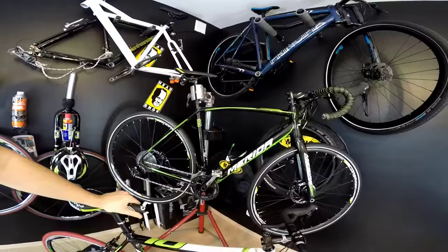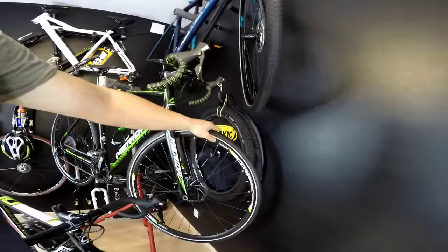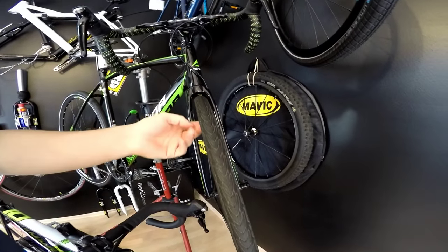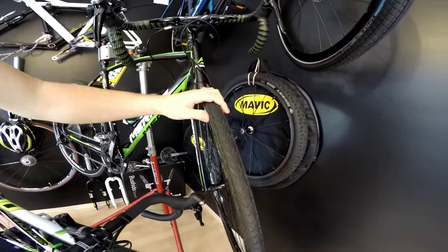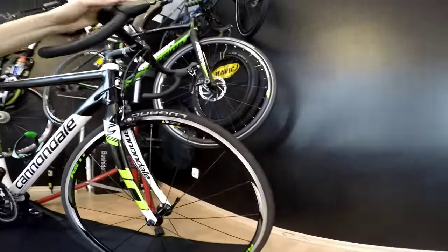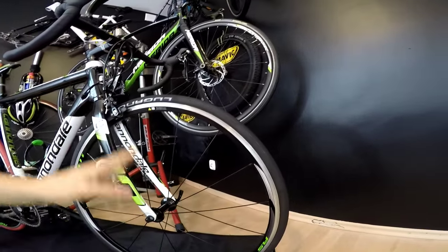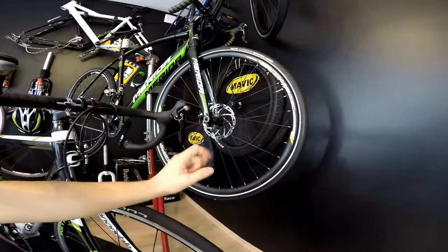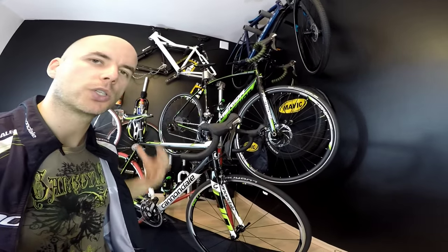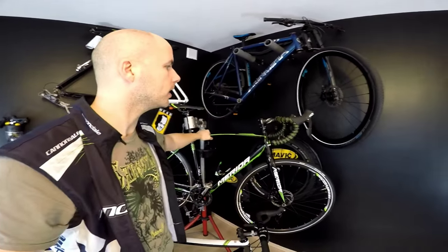The last thing is the tires and wheels. The tires are wider on the cyclocross bike, but these tires would actually be useless during cyclocross racing on mud and sand — I'll explain why in a moment. As for the wheels, the cyclocross wheels are much stronger: the road bike has only 16 spokes, while the Merida cyclocross has 32 — twice as many — so the wheels will be much stiffer, stronger, and able to take much more punishment.